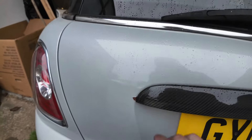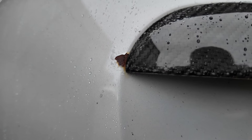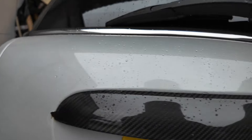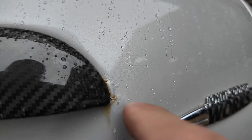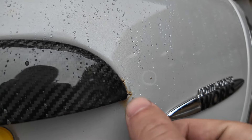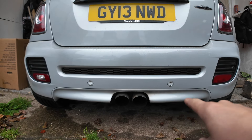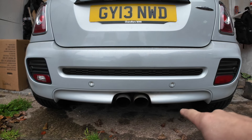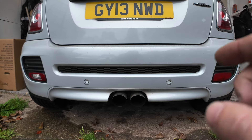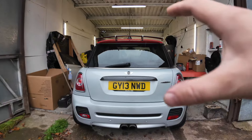A negative is that the carbon fibre boot trim has pushed in and cracked the paint, allowing a small rust bubble on the left-hand side — no bigger than 5p — which I am going to address. It's also just starting on the right-hand side. I'm guessing the trim sits tight against the paint and years of vibration chip it away and allow water in. I also want to remove the lower silver trim piece between the exhaust and bumper and fit the challenge aerodiffuser — it gives a nice aggressive touch without going too crazy and really makes the lines of the rear end work.